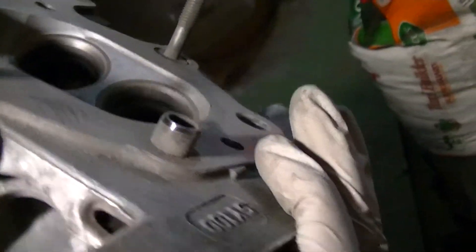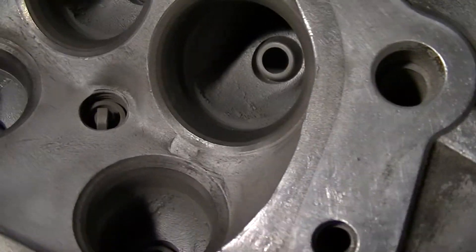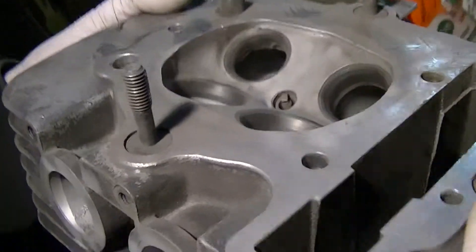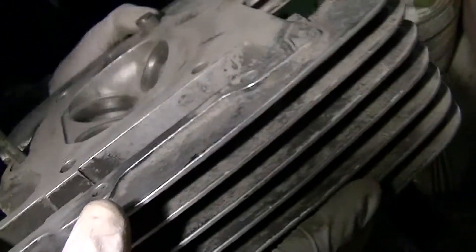Okay, we're going to port most of it and then we'll see. Look on the very top. Oh, that's perfect. That was a lot easier to hit though. What's the top? Okay, let's look at these. Make sure all the carbon's off the walls. Under, around. Is that good? Because we'll start the porting.